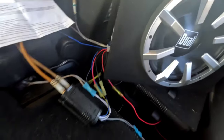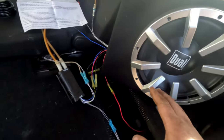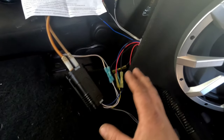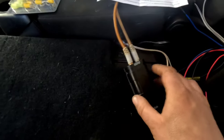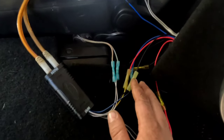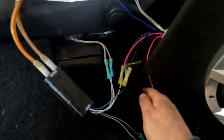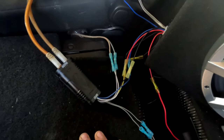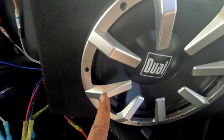Got it all tuned up — sounds really good. I'm going to do a sound test in a second with the actual microphone set up out here. This unit has a control knob that I'm going to mount up front so she can turn it up and down as needed. For the rest of the install: tape all your connections, make sure they're good and tight, and spray some battery terminal protector on that ground — kids reside back here and there are a lot of spills. Also spray terminal protector on your positive wire up under the engine compartment — that'll help out loads.